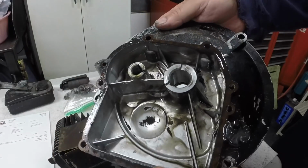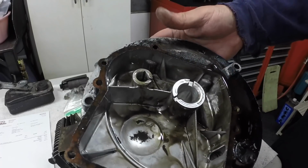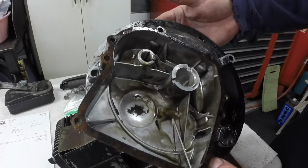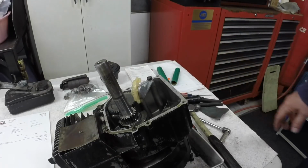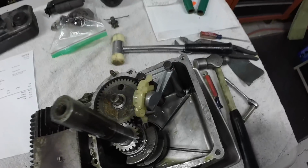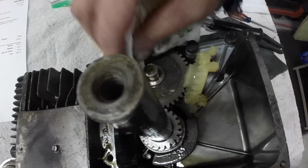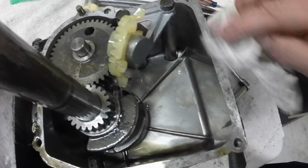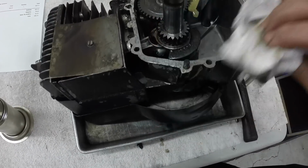I'm impressed. This is the gasket that's leaking, and I'm not gonna take that gasket off until I compare it to the new one to make sure it's exactly the same size. Otherwise we're going to be putting sealer on that one and reusing it. Yeah, the inside of the engine is super nice and clean. Wow. I didn't expect that. Yeah, that is nice. I'm not going to take any of it apart because, like I say, the thing ran excellent. Absolutely ran like a clock.